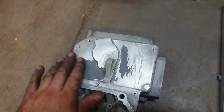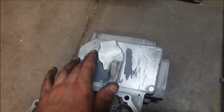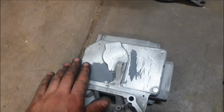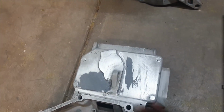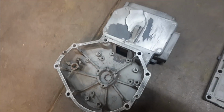So I think we've done a pretty good job considering we had weld coming all around here. We've gone and cleaned it all up nice and tidy, bogged it up with JB Weld wherever there was a bit of pitting, and then we've just gone and sanded it back all nicely. Should powder coat over quite good. Fingers crossed, look really nice.